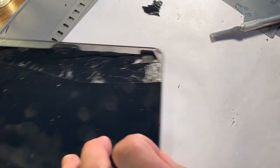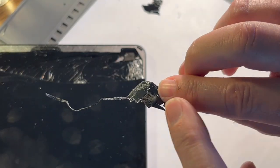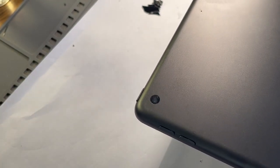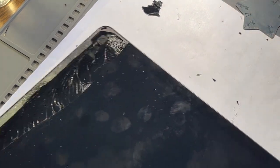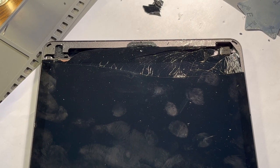When you pull that up, you'll see that little square — and this was the adhesive. It does peel away once you lift the glass. You can see where that camera was stuck to the back of the glass. Since I ran that tool around there, I was able to pull out part of that adhesive. That's the adhesive; there's the rear camera — so take care in that area. It's easy to figure out where it's at, just look at where the camera is. I'm going to just run the tool on this edge a couple more times and then show you how to lift the screen once the edges are all cut.